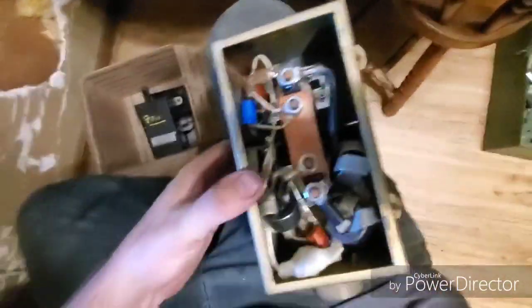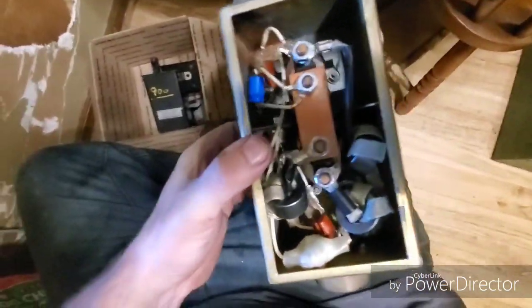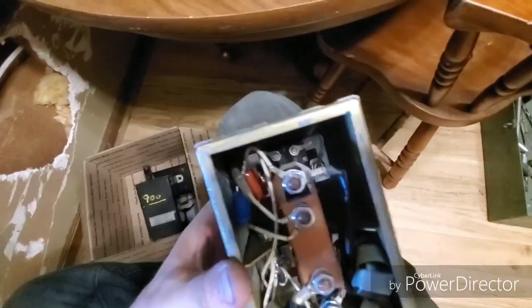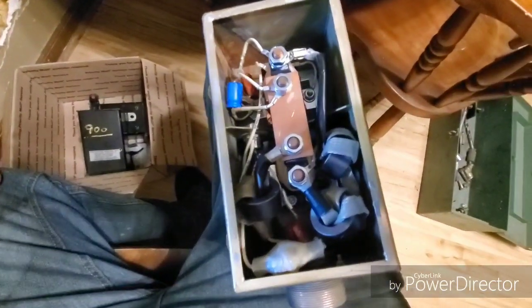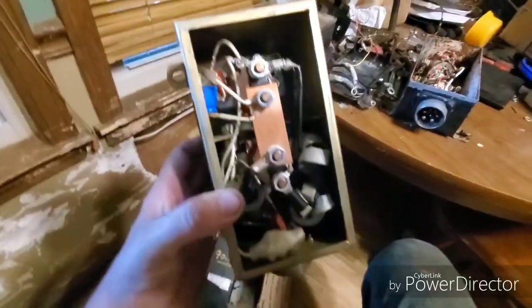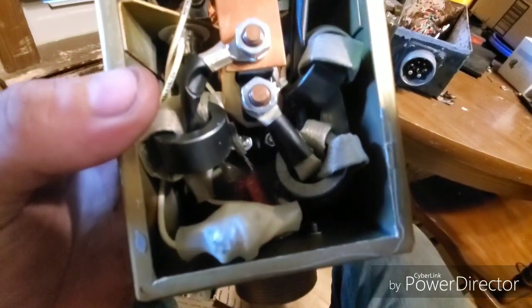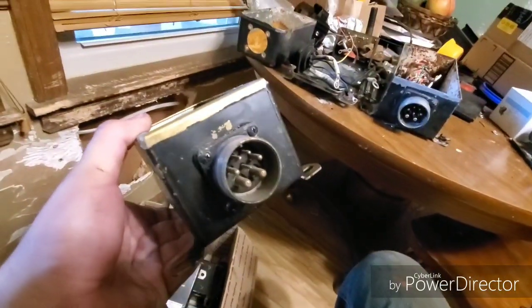I think this is a second-generation box they made — a little weird and complicated. I usually gut it and go with regular solenoid stuff like on the rest of them, making my own jumper wires and diode connectors. You don't really need all those diodes, other than for circuit protection. This thing has about 30 feet of ground wire that's not even needed.